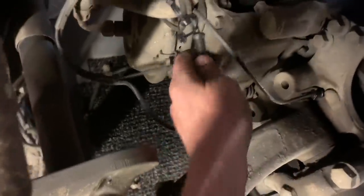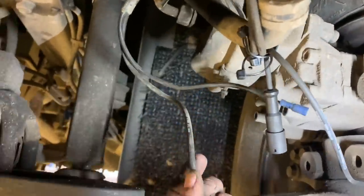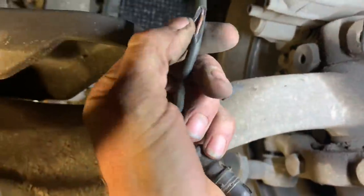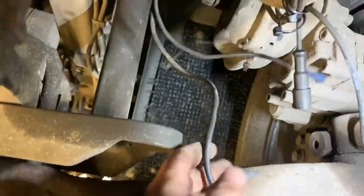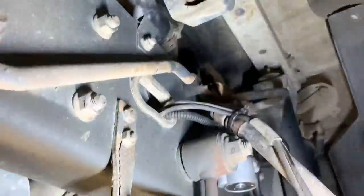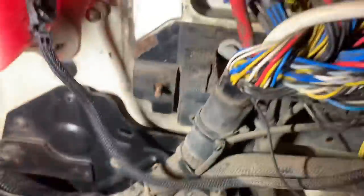I'll do it again to that one. But the fault DAF said is coming from the near side front, so I've still got to find this little one at the other end. It's black and brown because they're cut into it — definitely black and brown. It's up in the chassis there and then into that main loom, which is the big fat loom. So now there should be a black and brown coming out of this big loom here.